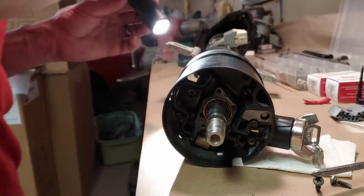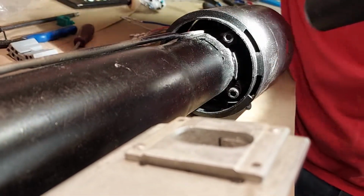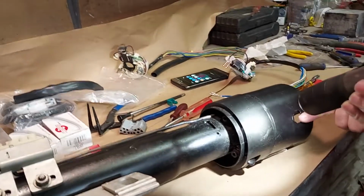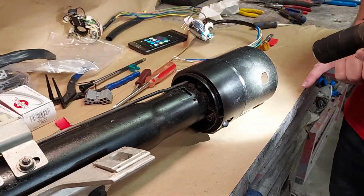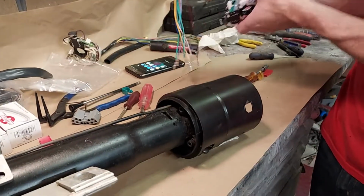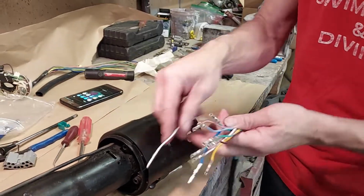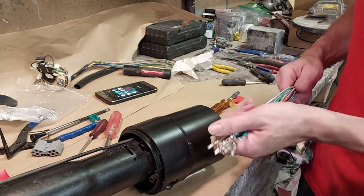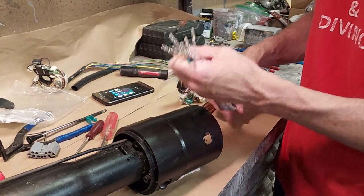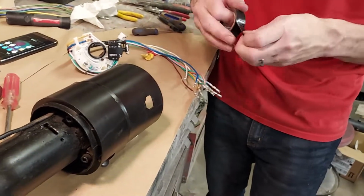And when they want to come out over here, Christina, if you want to show. On this column, they'll come out right here. Okay. Which is about straight in line with the hole for the turn signal switch. And there's a couple ways to do it. You could feed each wire one at a time, like that, or you can try to feed them all at once, but obviously you're gonna have these things fray out and make a mess. So I like to tape the wires together and stagger them so they're not so big.